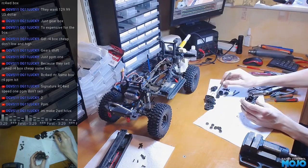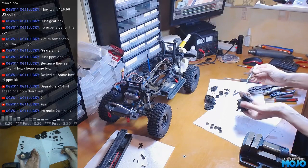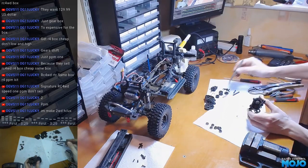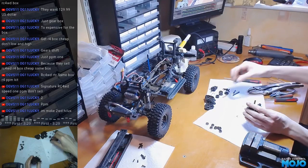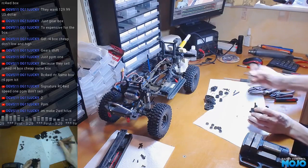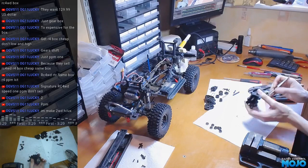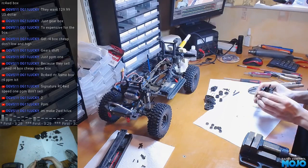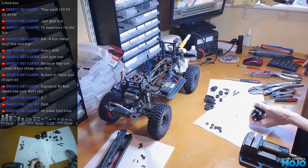Weird. So got that. There's another shim. And there's a slightly rusty bearing deep in the bowels. That's going to be interesting to remove. It can just come straight off, as does the pin. Looks like the water didn't quite get in all this way. That's nice. So the spur gear has got to come off, because I can't get the pin out otherwise. Not very nice.